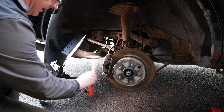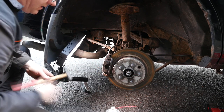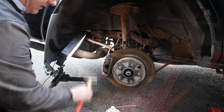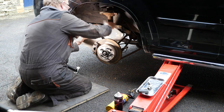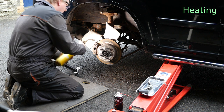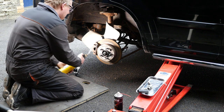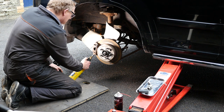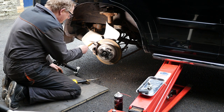So I thought gentle shocking — not too much, just enough to hopefully start shaking things up. Gentle pressure and plenty of time and perseverance, I'm hoping, would be the key to this. I'll give it a bit of map gas now. I don't want to overheat it — I just want to try and get those threads on the bleed nipple moving slightly inside the caliper so that when I do exert a twisting effect it will hopefully come undone and not just shear off.